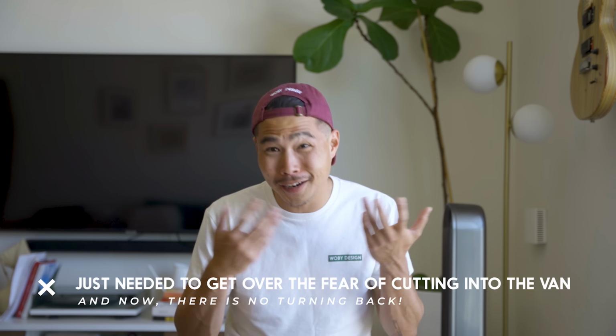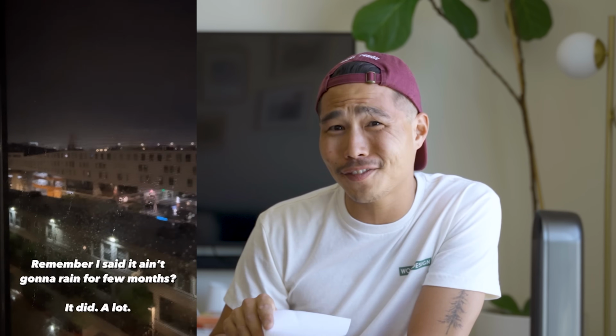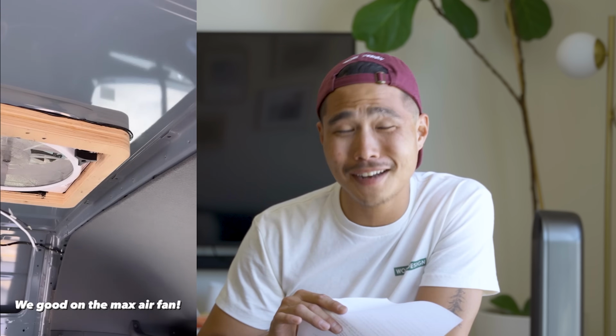Okay? Now, the entire process of installing a Maxxair fan shouldn't take more than a few hours. But overcoming the fear of cutting into a brand new van is something that might take more than a few hours. So I just made sure to double check everything and took my time to do things properly and learn as much as I can while I'm cutting, because I have a lot more things to cut into the van. And I think the most important part of this whole entire process is sealing everything watertight. Now, I did a water test once the sealant fully cured and I didn't see any leaks. And a few days after that, there was a rainstorm in LA and I didn't see any leaks and it rained for like 6 hours straight. So I think we're good.